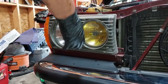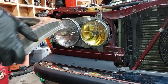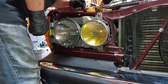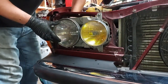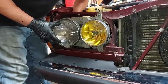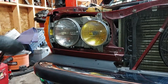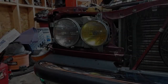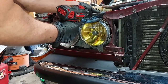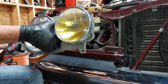Here we are on the passenger side of the car. I've already unscrewed the retaining screws on the back, and we're just going to remove the passenger headlight assembly. What that will allow us to do is get access behind it to the receiver dryer. To take this out we have one, two screws, one right here and one right there. We'll just set this aside, and there is our receiver dryer.